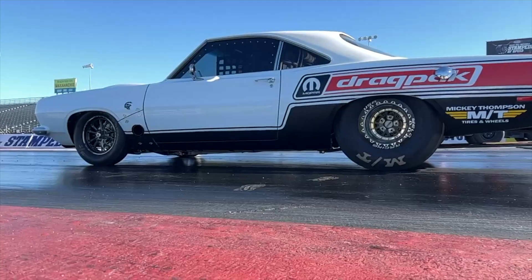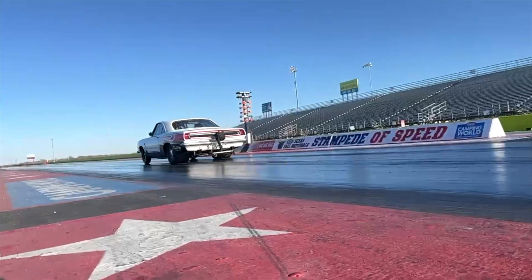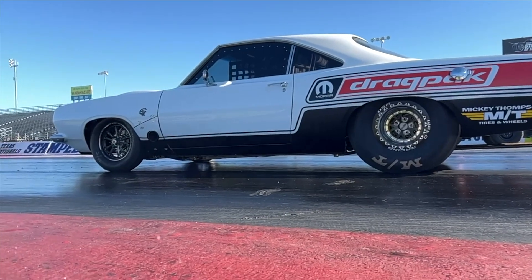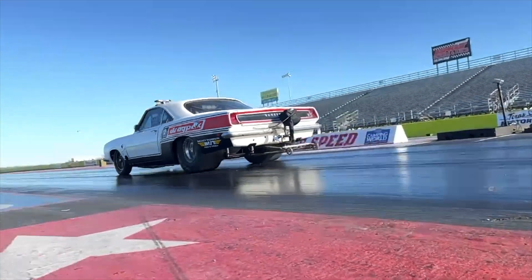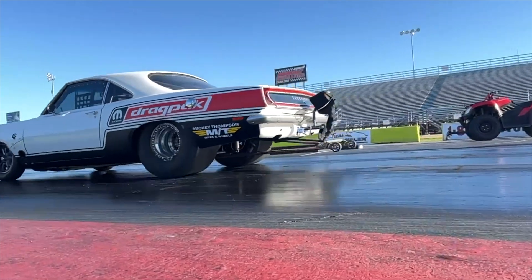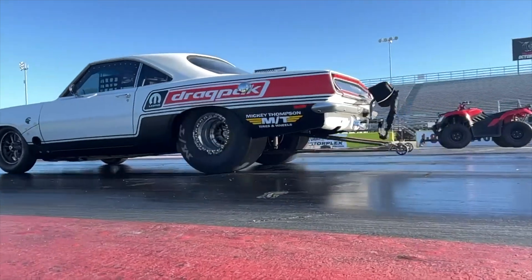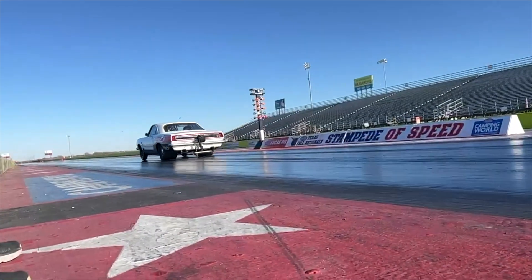With the top bar in the second hole from the bottom, let's see how this looks. Notice how hard it throws the wheel to the track — it really hits the big tire sidewall really hard. The car pretty much bunny hops, leaves the track, unloads, and goes nowhere.